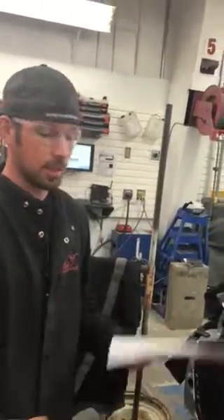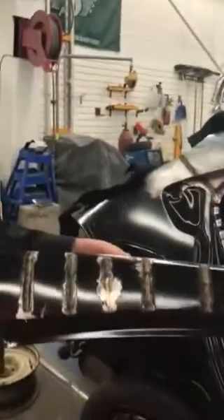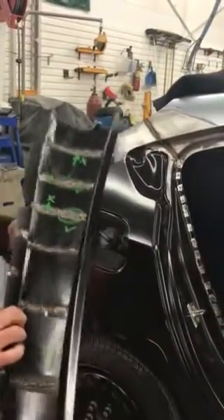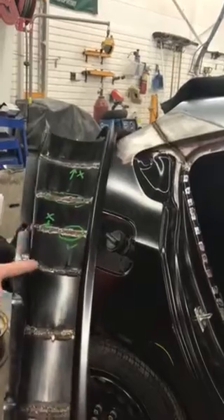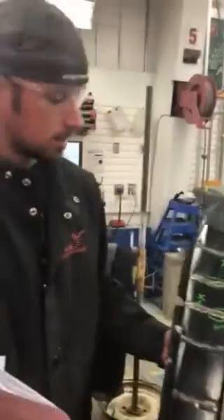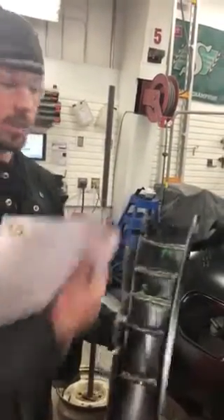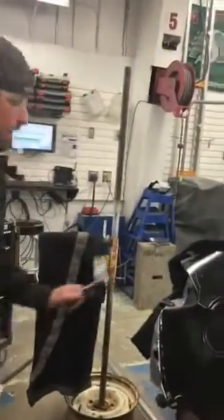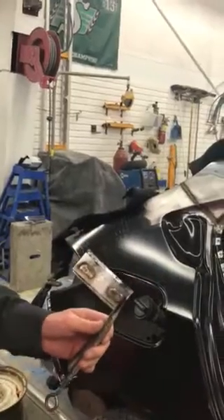With that, your extra time is definitely put into doing your test welds and practice welds. You take the material that you're welding, cut it just like you're going to do on the vehicle, and check for proper capillary action on the back side to make sure your joint is going to hold for your braze. I took six test welds to make sure I was getting a proper braze for my section joints, and then started doing test brazes for the slot joints as well.